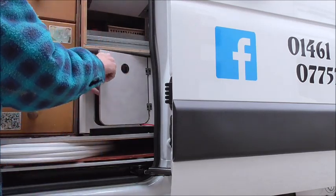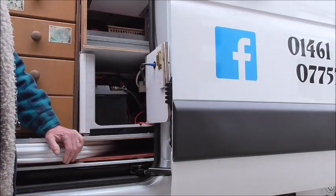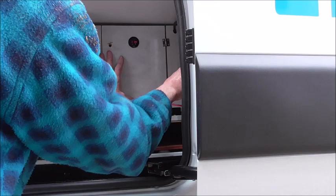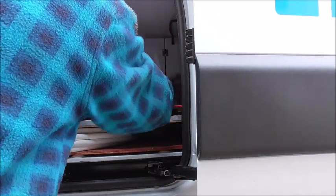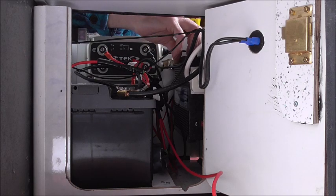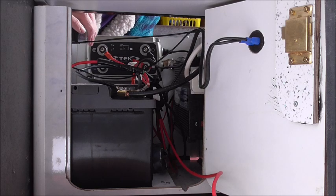I've got a cabinet lock just so that I can keep it locked when I'm moving around. Inside, battery and all its relevant bits. Now to see in there better I will just push this out of the way. The wires have been made long enough so I can slide it out to do some work on the inside when I need. Inside the battery box we've got the battery, the auxiliary battery charger, then the inverter — the 240V inverter — the CTEK DC-to-DC charger, and an auxiliary fuse box, a six-way fuse box.